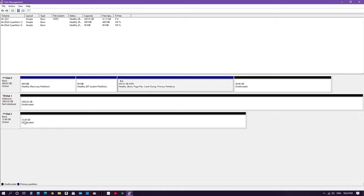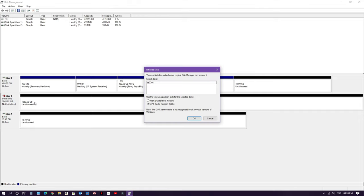As you can see, my 16GB Intel Optane memory is also displayed here. It may not display at the first instance because you need to install the software and drivers first — I have already done that, which is why it is visible. Disk 1 is the 2TB hard disk drive. The red symbol means the disk is not initialized yet. As soon as you open disk management the initialization pop-up will automatically come, but if it doesn't, right-click and select initialize disk.